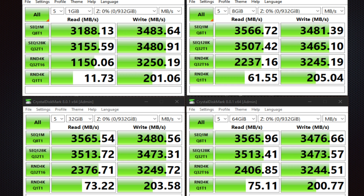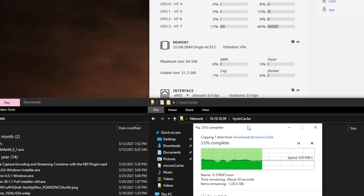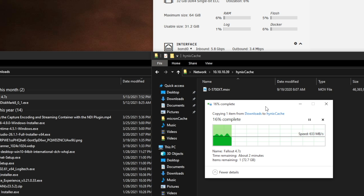I'm not going to read these off to you — you can see this drive performs pretty well. We used CrystalDiskMark, and there's plenty of data online already. For real-world testing, I took a 42-gigabyte movie file I've used for a couple of years and transferred it over the 10-gig network. We saw approximate peaks of 900 megabytes per second — I don't think I ever saw anything above 900. For the next test, I took a 94-gigabyte zip file and also tested that across the 10-gig network, seeing similar speeds of around 900 megabytes per second.